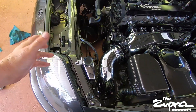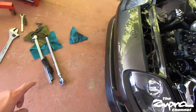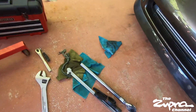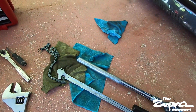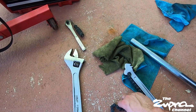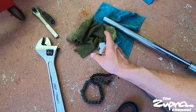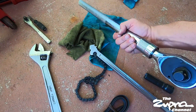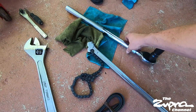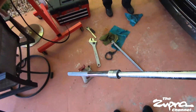Quick recap: tried with the gun that we put it in with - won't budge, won't come out. The socket was getting burning hot so we stopped. Called my buddy Abraham - shout out to him, Smith Racing. He gave me this technique. He's been doing 2JZs for a very long time. He said to use this chain block with a piece of belt to lock the pulley in place, and then gave me this tool with an adapter. He says just gotta get it done - this expands by the way. Should get the job done.